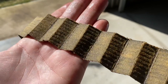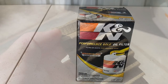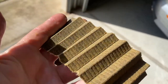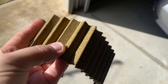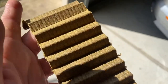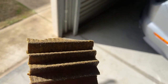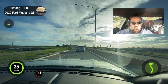As a comparison, I have the K&N filter which I put on from 7,700 to 11,700 kilometres, and as you can see this filter is actually quite clean. This shows me the engine isn't in a critical state where it's eating itself up. The running-in period did produce some metal shavings, but after the original sump and run-in it looks like the engine has settled down and is performing quite well. Oil consumption has dropped right off — it's not actually burning or consuming any oil at all.